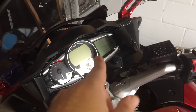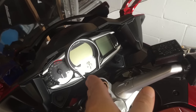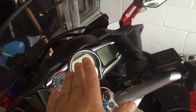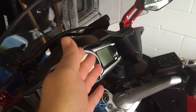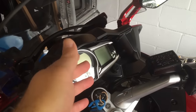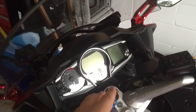I know this is a mechanical issue, and here's how I know: the only time it happens is if I brake really hard — first gear will not indicate until I accelerate very hard. So something is moving forward and back with the momentum of the bike, affecting the first gear display not coming on. It's totally blank. It's not that it doesn't go into gear — it's nothing with the engine or the transmission itself — it's something with a signal.